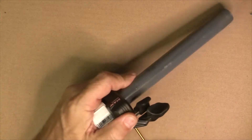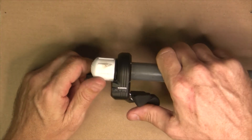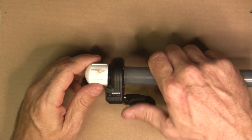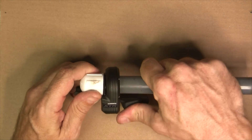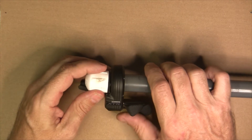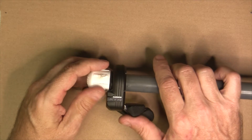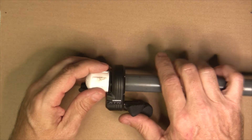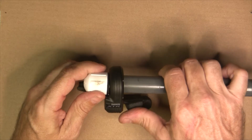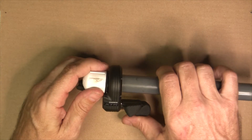That's the amount of pressure it takes - it's significant, I'd say it's close to a mechanical shifter. The reason I'm wanting to use the Di2 shifter is because I've injured my thumb and I was hoping the shifting pressure would be much less. So I'm going to take it apart and show you the springs inside that make it hard to shift. There are actually two torsion springs and two extension springs, and I'll show you how I brought the shifting pressure down from 2800 grams to about 300 grams. You still get the tactile feel of the first and second click, but it's significantly less pressure.